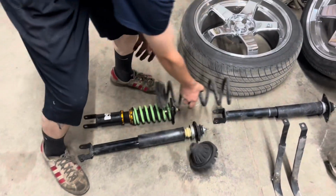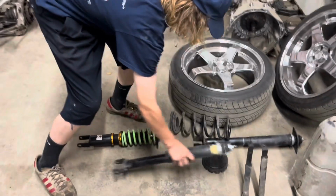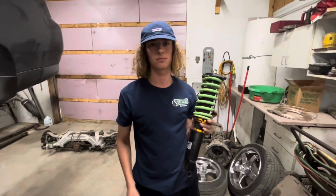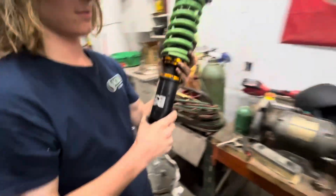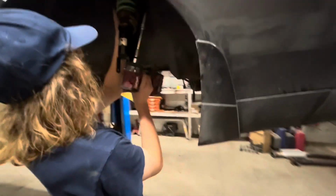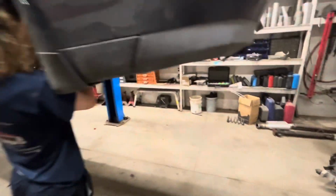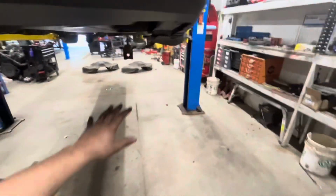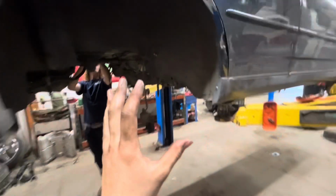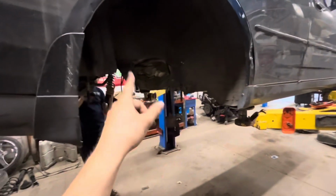All right, we're completing a side quest out here. Right now we're squatting Ty's G35. We had these coilovers sitting around that Matt Calkins, a good homie of ours, gave us. Well, we just adjusted the spring rate and the ride height since they were kind of wonky. He said that when he drifted, the car would kind of three-wheel at some points in the rear. So we're gonna see if adjusting the spring rate and the ride height to match is gonna fix that. And then we'll get back to putting the gas tank and subframe in.